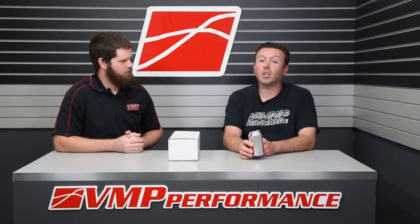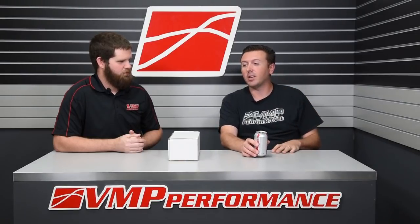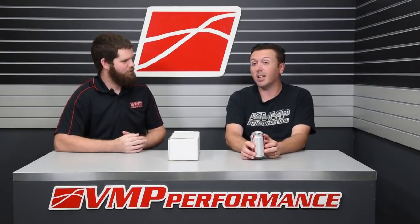Yeah, so that's what he was talking about. I think he was talking about just the advantage at low RPM, the torque to get you off the line with the F-150 manifold. But honestly, we don't know in a transient state off the line. About the only way to test that is 60 foot. And it may have some more air velocity that gives you a bigger shot of air charge, because at that point, it's air and fuel once it passes the injector.